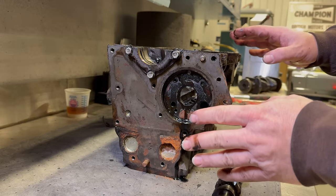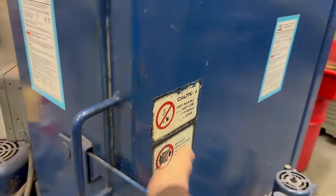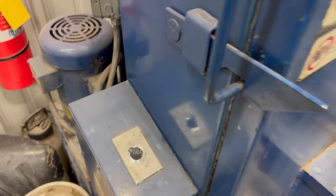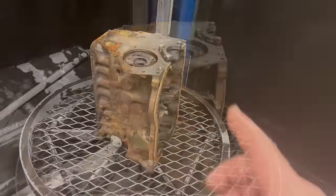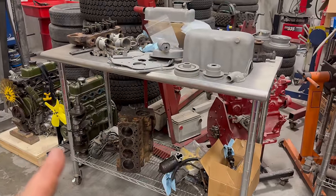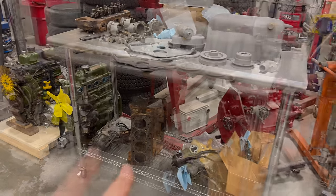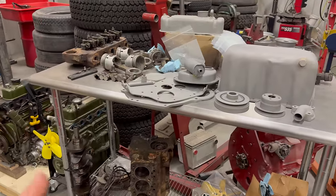Now the block itself is ready to go into the engine washer. I'll get this washed off and then everything needs to go to the machine shop. That is really clean now — I need to get this out and dry everything off so that nothing rusts. Now that everything is cleaned up, I need to get the block and the head over to the machine shop. I'll get the pistons over there and we'll figure out how far we need to bore this block out. One little trick: you can zip tie your crankshaft standing up so it's not going to fall off your table. In the next video I'll go over all the new parts and everything that needed to be done to make this engine right again.